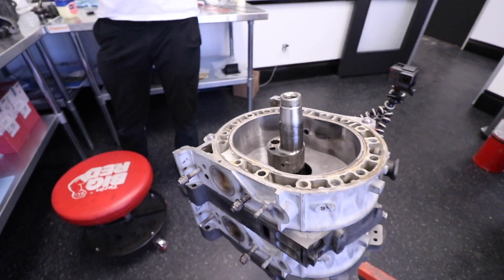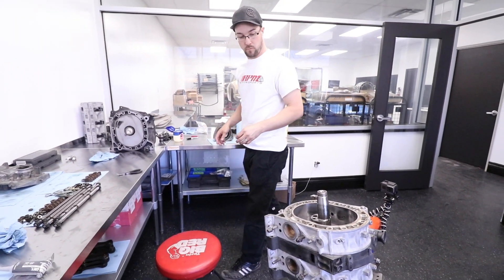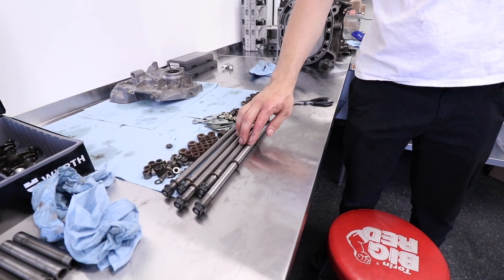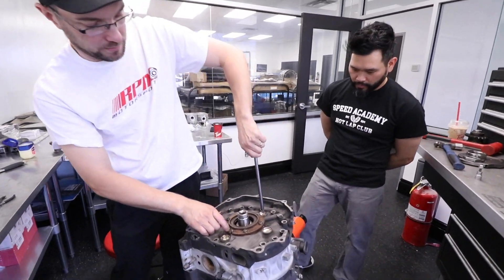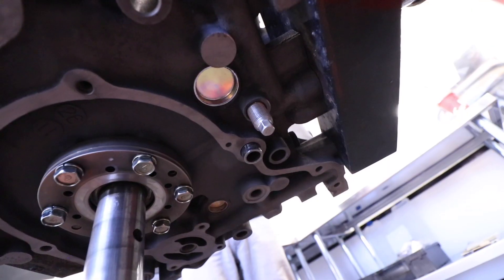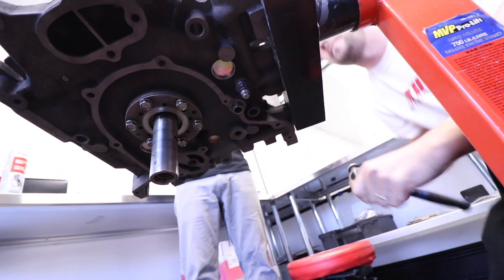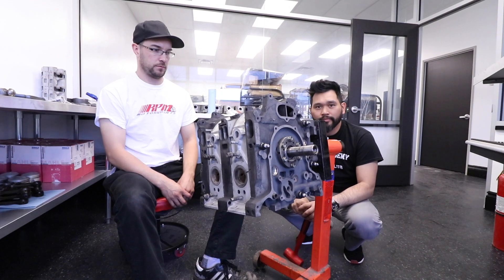We're visually very close here Joe. One more iron — rear rotor's built and ready to go. We just need to drop it in, put the springs in the apex seals, rear iron on, and then we put the through bolts in. We also have the Goopy full through bolts that go right through the whole motor, with nuts on either end. Those will go in before we torque up the factory bolts. These go straight from the back of the motor all the way to the front and are a machined tight fit. Nut and washer from this side, and we tighten those down. With those Goopy studs in there, these two studs are calling it a wrap.